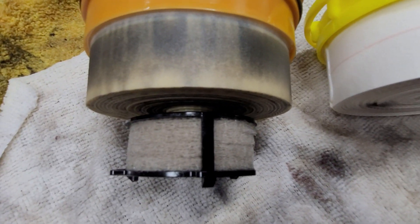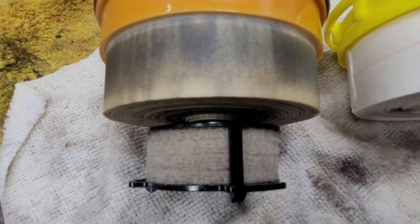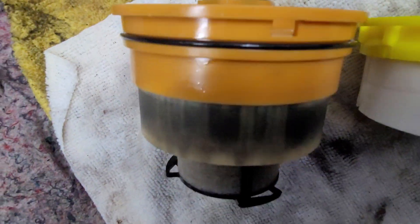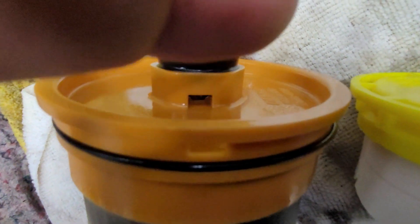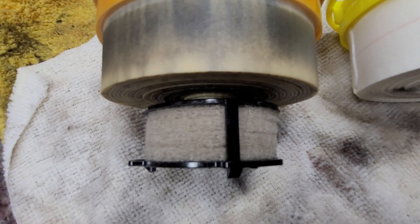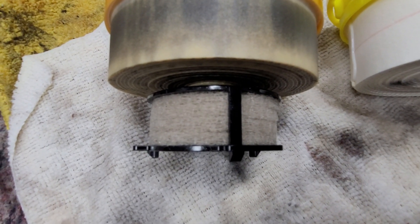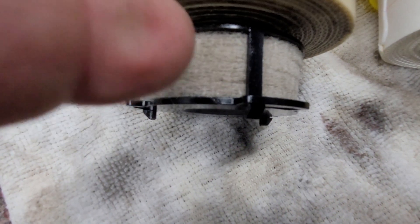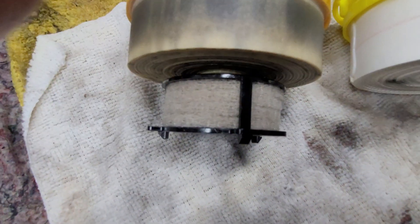What they've added is a pre-filter. It's very important to note that fuel comes in around this outer bowl section, down through that little groove in the middle there — not through the top, through the groove in the middle. Down, pushed through the pre-filter down the bottom. So any water and anything like that, as it touches the surface, will drain off the bottom. So much more effective.